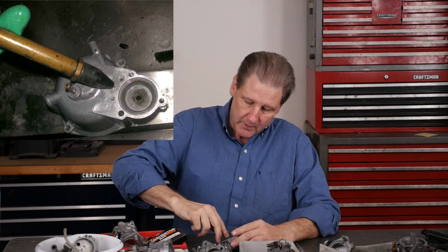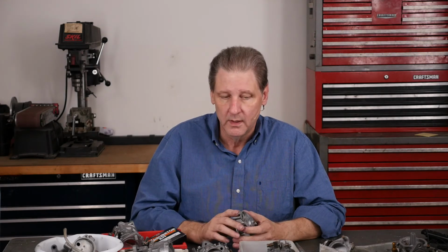I'm blowing it off, cleaning it good. I'll show you a picture of an air blow-off. It's got a little rubber lip on it. Put that lip right there, hit full air pressure, 100 and some pounds, nothing came out the brass. No spray, no squirt, no nothing. So that's when I realized ultrasonic might be fancy high tech, but it doesn't always do the job.